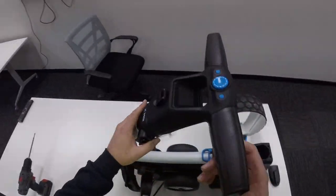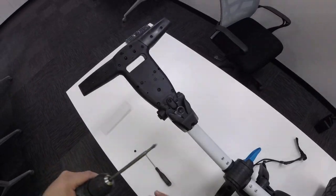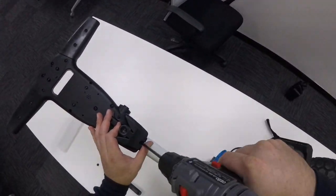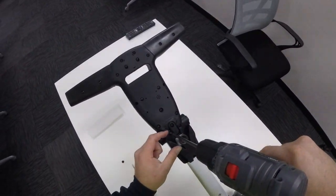So we'll remove that cap, put it to the side, and focus on the back plate of the top box. We need to remove all these screws from the back plate and we'll begin with the remote holder — that's three screws.